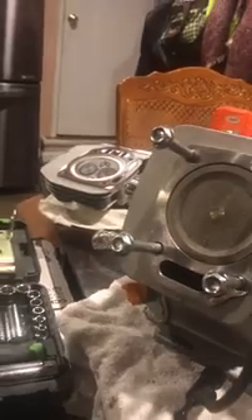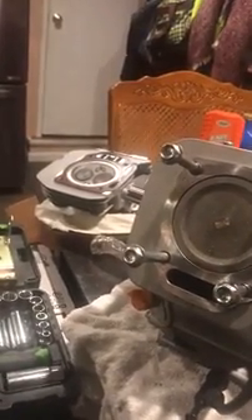That's where the Lifan piston sits, but this is dished, so there's power to be made. Flat top piston, along with the stroker rod — put the stroker in, use the stock rod, and when your piston's hanging out of the hole just mill it down. These heads have tons of clearance. You can make up 40 thousandths just with a gasket, then have your head milled another hundredth maybe. That's for the future — we'll keep getting into it.